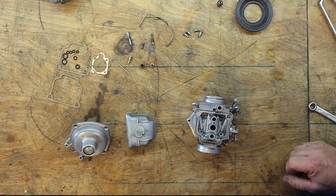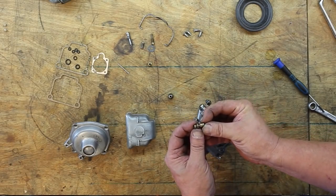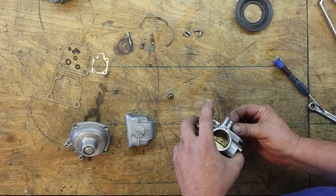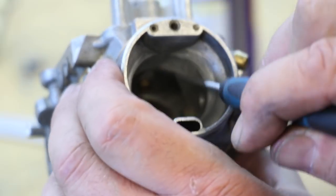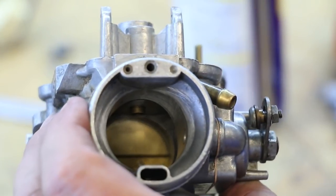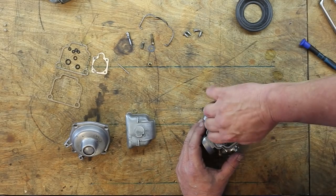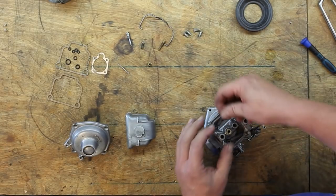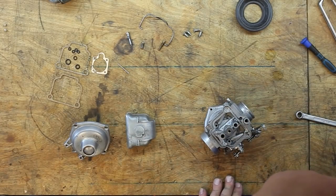Now let's get down to the bottom. I'm going to start with the center one — this is the needle jet and diffuser. They go together: the part without the holes goes in first, so you can push that through, drop it in, and give it just a little bit of guidance if necessary. You know it's all the way in when you can see that much protruding through there. Make sure you don't get it cocked in there before you tighten it or you could do some damage. I've put the new O-ring on this and I'm going to screw that in — just snug, don't need to go crazy. This little washer goes in there and the main jet — always have a look through. Perfectly clean, ready to go.